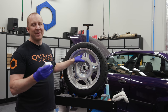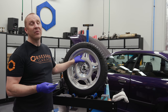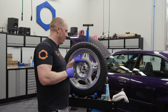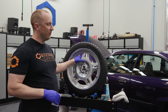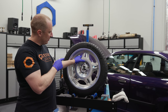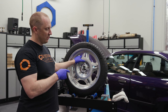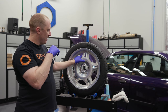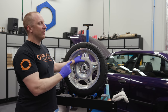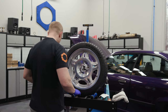I'm going to do two coats of Deluxe, but not back to back. I talked to Corey from CarPro USA — he said wait three or four hours between coats. So I've been working on the car and doing other things while throwing a coat on the wheels at a time. First we'll prep the tires, then clean the wheels, then put a coat of Deluxe on and wipe that off. Three or four hours later — probably tomorrow — I'll apply another layer, then three or four hours after that I'll put a coat of Gliss on, and then they're done. That's the plan.